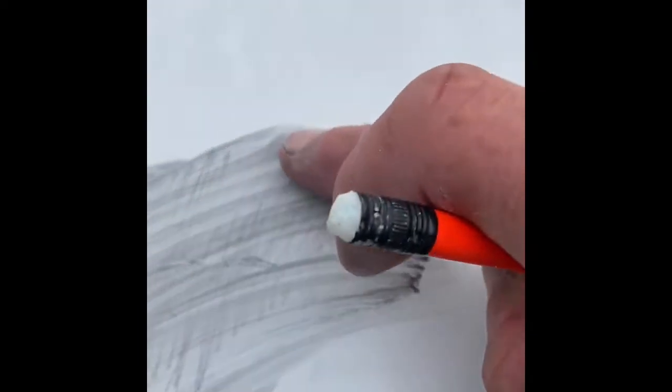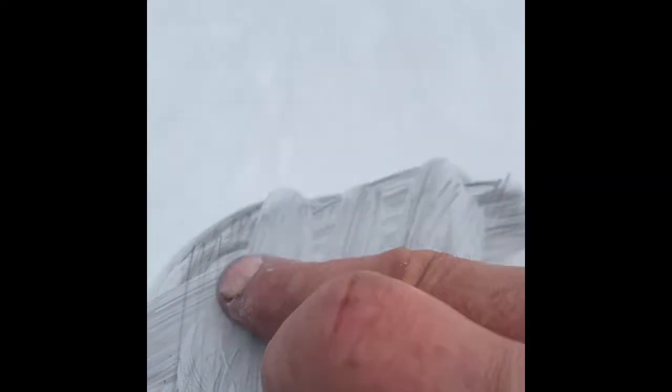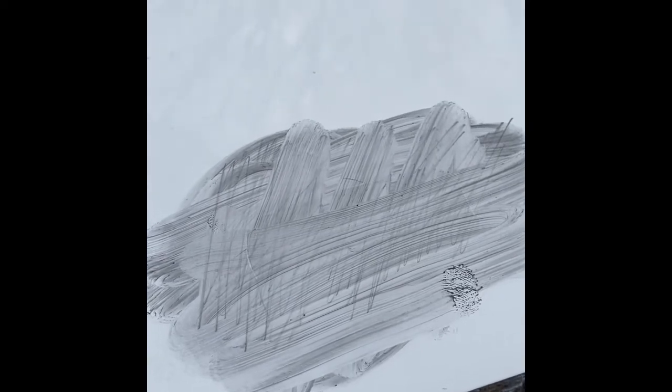The fact that we can't really even feel a lump - it feels completely smooth to the finger - it's now time to change grades. Next grade, we go down to 1000, and at that point we want to get these lines or the edge of our repair to completely disappear.